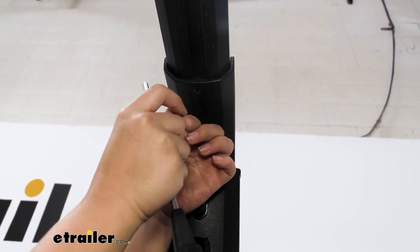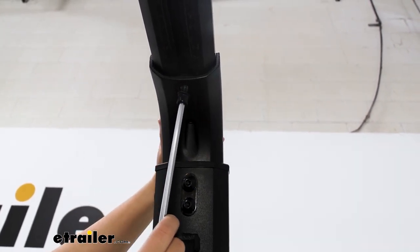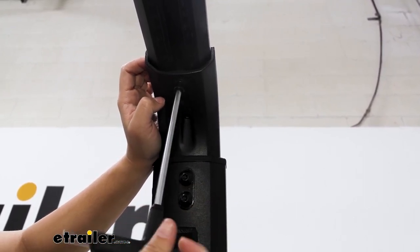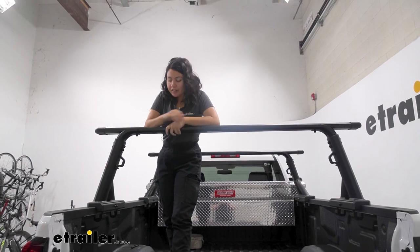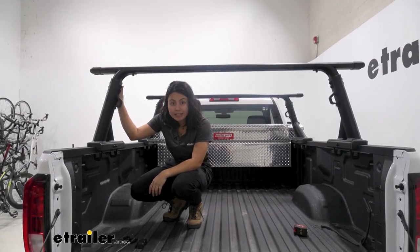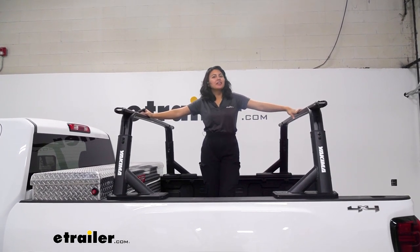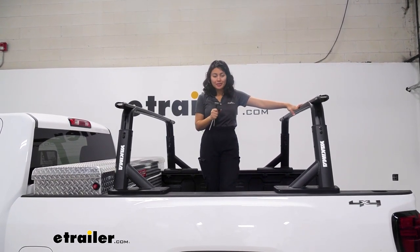We have these smaller bolts with a split washer and flat washer on them — they're also security bolts. See how there's a little cutout? You really have to use your Yakima tools for this one. Put it onto the Yakima allen key, and holding the tower into place, secure it. Make sure the thread is lined up before tightening down with the bolt. With four of those bolts per crossbar all tightened down, double-check that things are secure. At this point you can also make your height adjustments for the ladder rack using the medium-sized tool. That's your install process. Make sure to put your tools and keys in a safe place for when you need to uninstall this again.